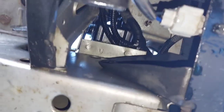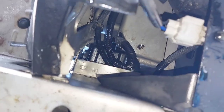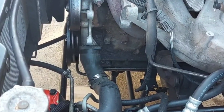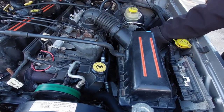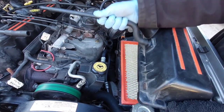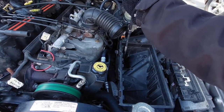As a form of preventative maintenance, whenever you replace the radiator you should also replace the thermostat — I have a separate video on that linked in the description. First step is to drain the coolant. There is a petcock valve on the passenger side, but it drains very slowly and makes a mess, so instead I'll drain by detaching the lower radiator hose from the water pump. I'll also remove the airbox by snapping off the cover and removing the three half-inch bolts on the bottom.